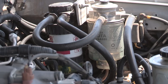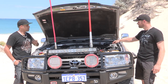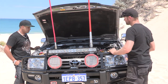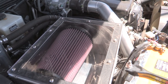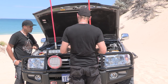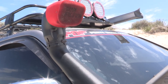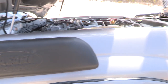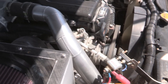Factory and aftermarket. The Fuel Manager — how many microns is in your second one? That's a 30-micron one. That is a huge air box. Yep, that's a custom air box made by On-Track Fabrication. I've just put a Perspex lid on it so you can check the filter — instead of undoing all the screws, you can just have a look through the window and see if it needs a clean. And you've got a Safari snorkel? Yep, Safari snorkel, plumbed up to the custom air box. Uni-filter on there for off-road just to obviously keep that cleaner. And that is a four-inch induction? Yeah, four-inch reduced to three to the turbo.